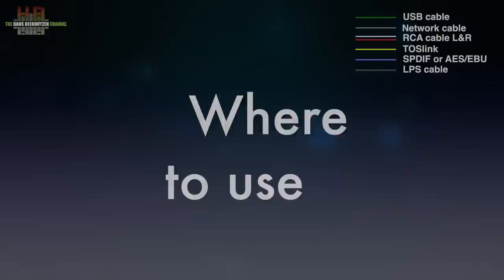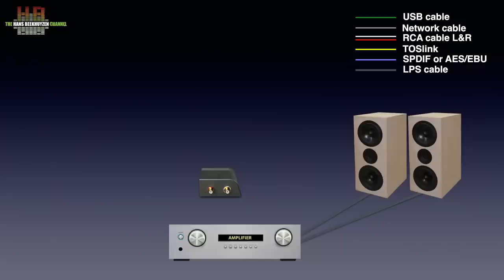You need a stereo with a free analog input on your amplifier. The two RCAs on the Amazon Analog have to be connected to a stereo line input on the amplifier or receiver, for instance the CD or AUX input. The network connector on the Amazon is then connected to the network router using a network cable. There is no WiFi option.